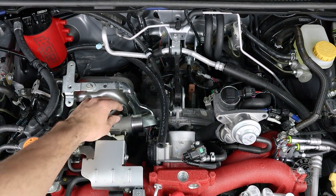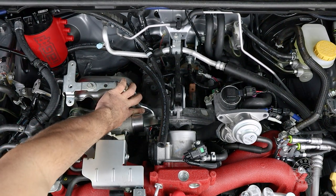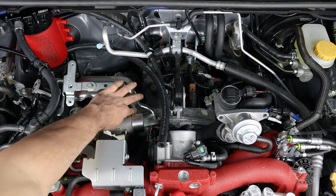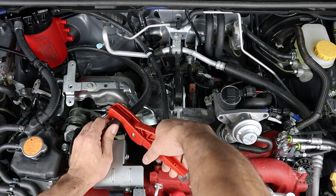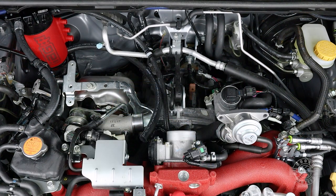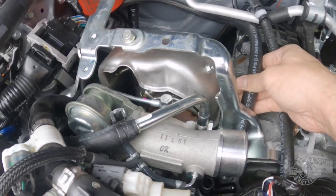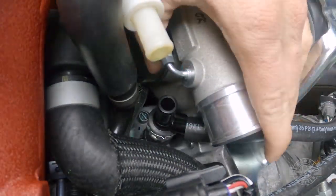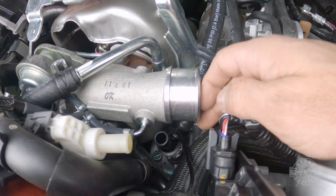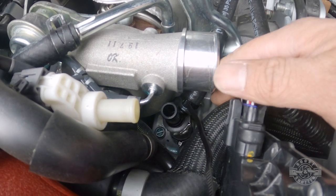Now finish installing the drain line — the line that dumps the oil back and the whole reason for this device. The line goes through this hole and installs onto the half-inch side of the Y-fitting installed earlier. Leave some slack on this hose so I'm only trimming a little bit. Put the hose through the hole next to the Y-fitting, then simply push it right onto the barb. If it's very difficult, lubricate the hose with oil. Secure it with zip ties and trim the excess.